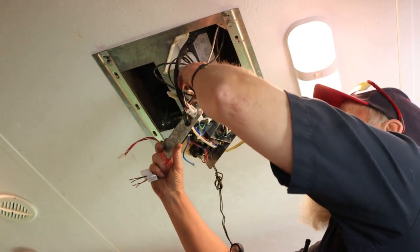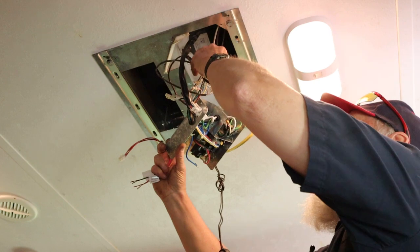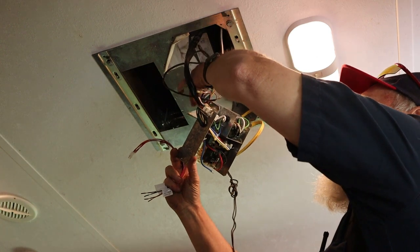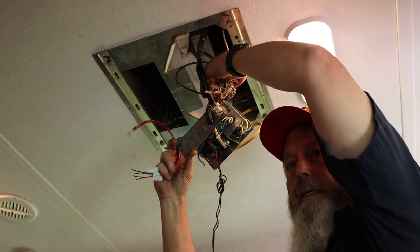We have our brand new one, which also comes with a thermostat and a little wiring harness. Now this is kind of where this gets tricky, because our old box has got eight control wires and a power and a ground. We're going to be reducing that to a power and a ground and two control wires. So pay attention - this is where it gets tricky.